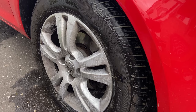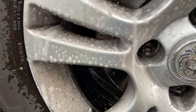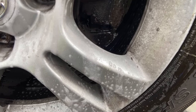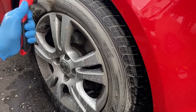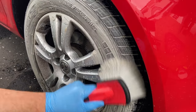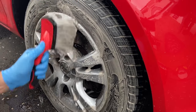The cleaner itself is a thick gel and takes some effort getting through the trigger. Anyone who's used EZ Car Care Geo Gel will be familiar with its consistency. It does cling on well though, and as it's not a foam the strength of the product isn't diluted. If you're unsure whether your delicate wheels are suitable, test on a small area first. As you'd expect from an alkaline wheel cleaner, it makes an excellent tyre cleaner too. These huge sidewalls on the 15-inch tyres are ideal for this soft-tipped alloy wheel cleaner brush — the edges are rubber so you won't damage anything.